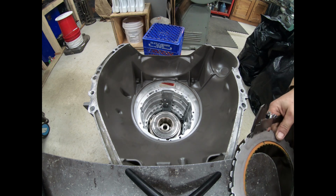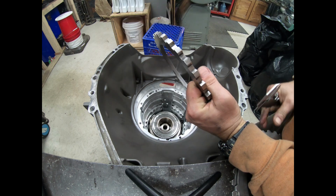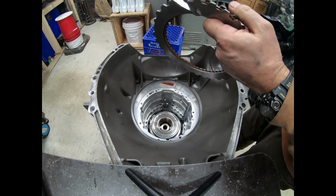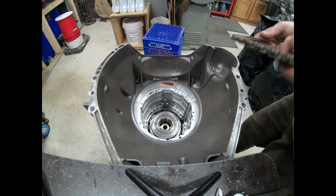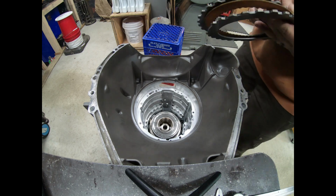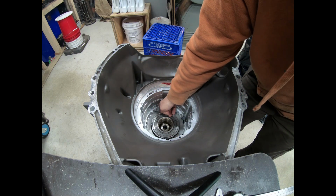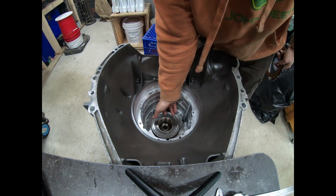Well, right off the bat, you can say, let's replace this 325 thousandths thick pressure plate with 2 1/8 inch plates and our 4th friction. That's a little bit more than 325 thousandths. We could make that work, and that'll give us a stack up of almost the same. Well, let's see why this does not work. For one thing, we're not going to make any engagement with the case splines with that bottom 1/8 inch plate. So that's no good. That's not tall enough.